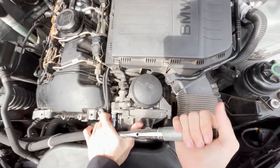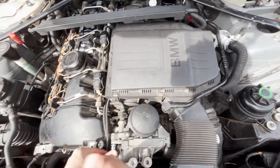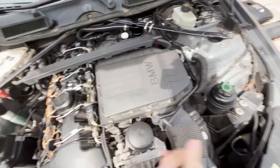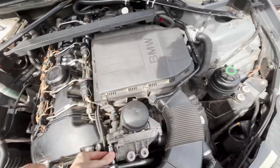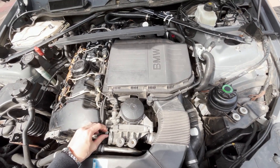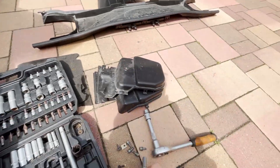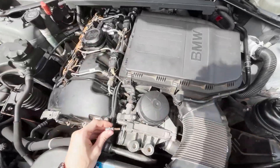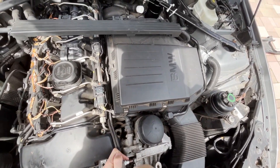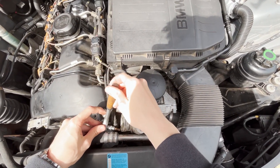Okay, there it is — we're going to loosen it. You can see there's a slight gap here, so make sure your seals are in good condition. Mine were changed recently with the last oil change so I'm not too worried about leaking. Now that this bolt is out, we switch over here. It's a T30 Torx head needed for this bolt. We're just going to loosen it up. This is spring-loaded, so the spring is pushing against this little cover.